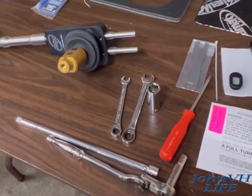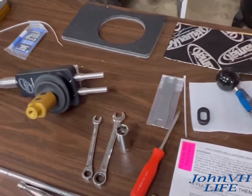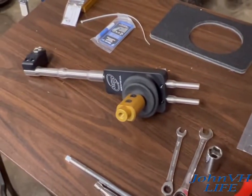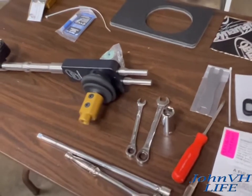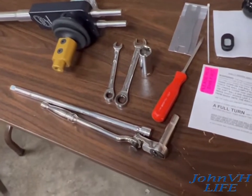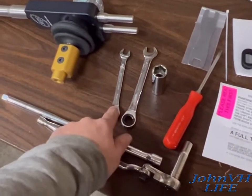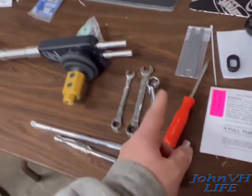Tools you're gonna need: the video I watched listed these things. It also said the shifter came with an Allen wrench but mine did not — maybe it's for a different style of knob or shifter. The one in the video for my car doesn't quite look the same as this, so I'll check MGW's site for more info. You need a 10mm and an 18mm socket, a 13mm and a 10mm ratcheting wrench, a long extension, 3/8 drive, and a Phillips screwdriver.